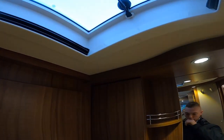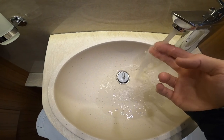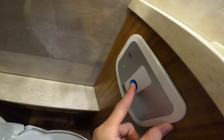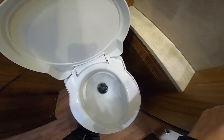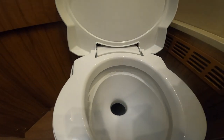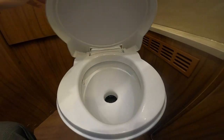To operate your toilet, make sure the pump's on — the fan will kick in. Press until it goes solid, then open the blade at the bottom: push it to the right which lubricates the blade. Use the toilet, then flush again, then you can close the blade. That's how you would use the cassette loo.